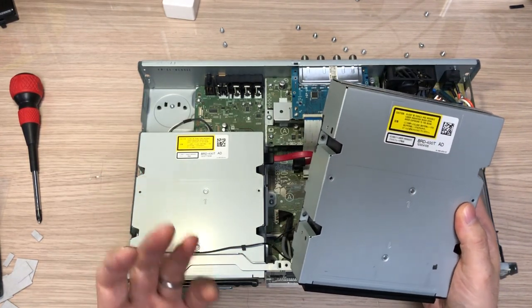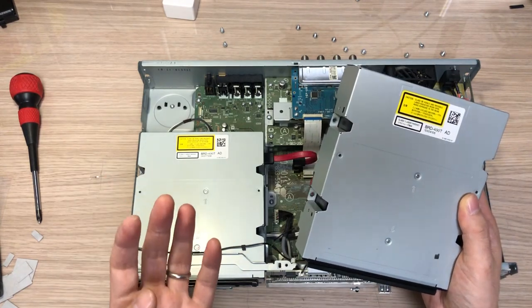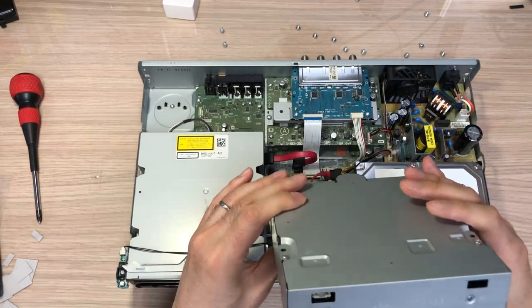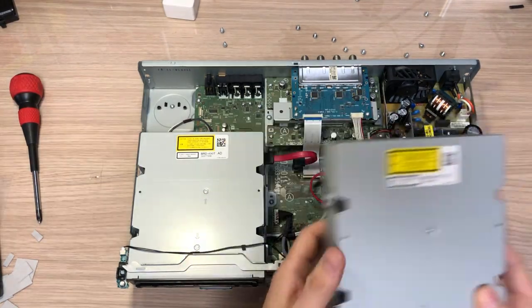And the first media to start failing is normally BDRE. Next probably BDR. And the DVD and the regular DVD RAM will probably fail last. That's the tendency I know based on my experience, but it could be wrong, depending on the different company.